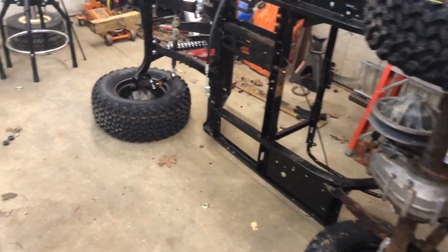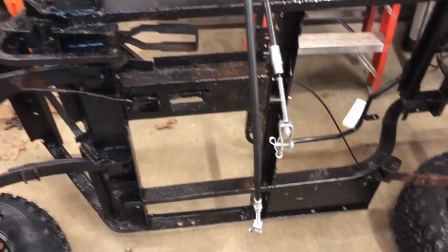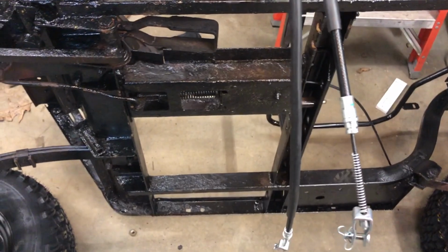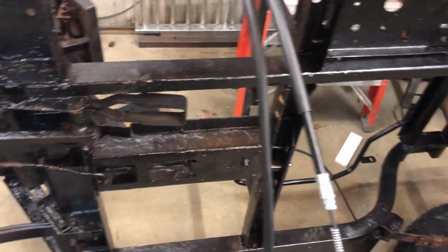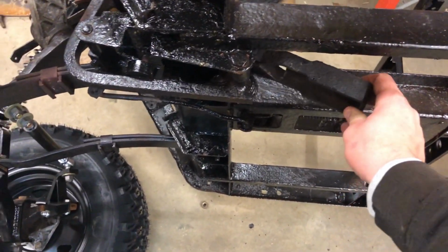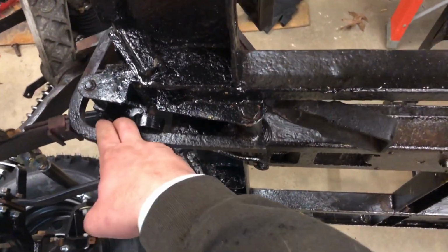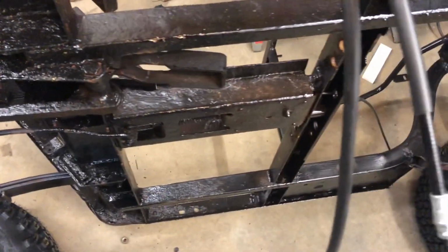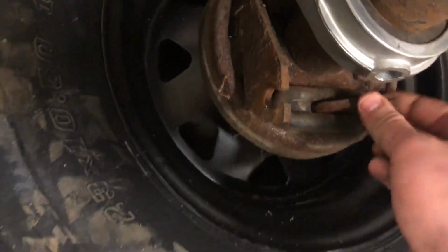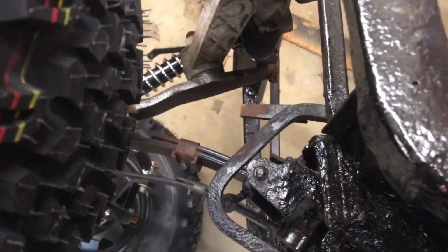So we got this thing in the service position, and we're going to be installing these new brake cable assemblies. So basically the way this works is this yoke type piece gets pulled on, or the shaft rotates when you hit the brake pedal, and it pulls this forward, which pulls on these 2 brake cables, and then they go back into these little receptacles on the brakes back here, and the parking brake is just like a locking mechanism when this goes past a certain point.